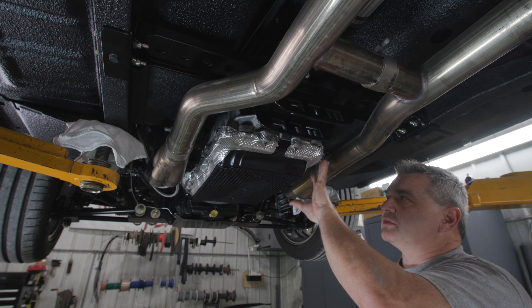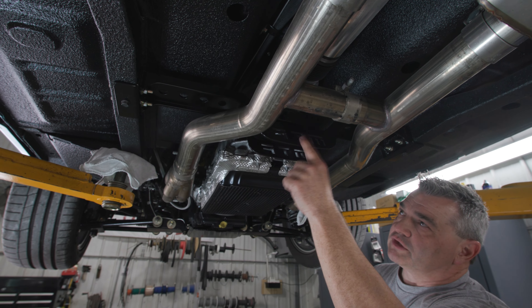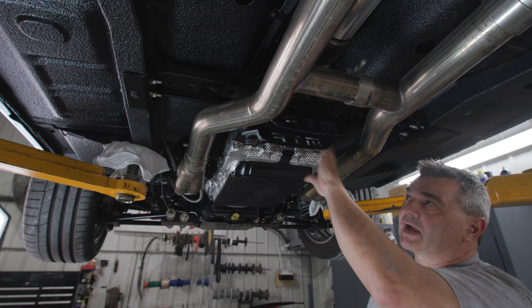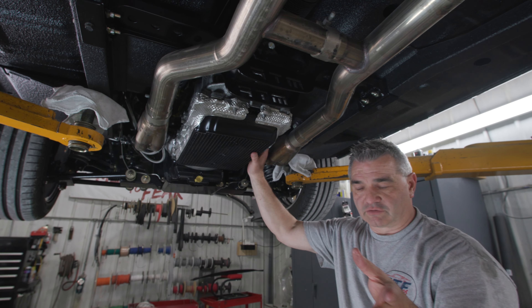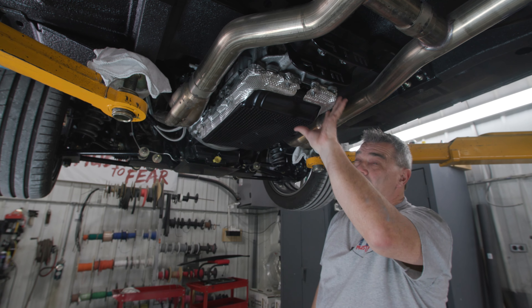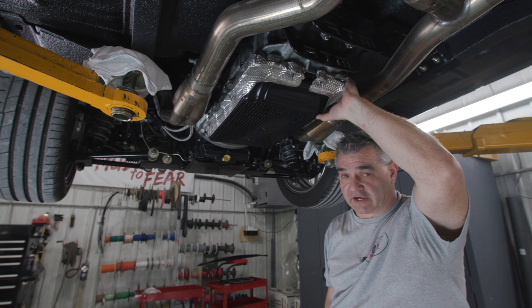Given that this one is the 10-speed, we actually developed an adapter that bolts onto the transmission bracket as a second adapter to accommodate this 10-speed. And in keeping with our mantra of working with what Ford gave us, we have managed to put this Coyote and this 10-speed underneath the tunnel without cutting the tunnel — that's right, we've done it.